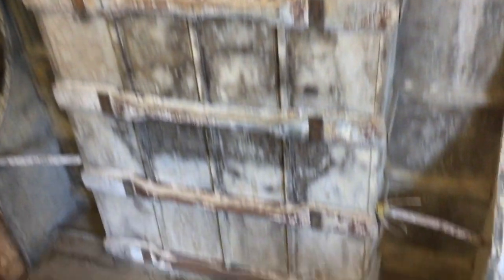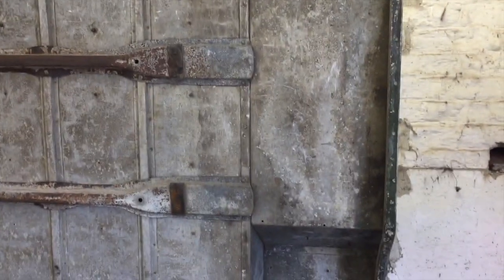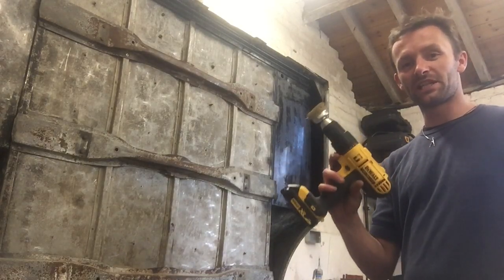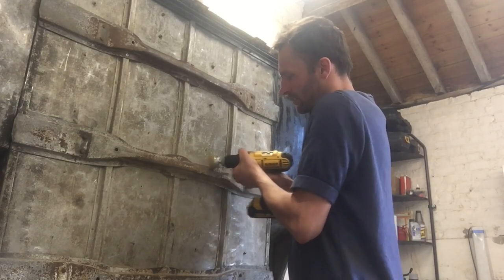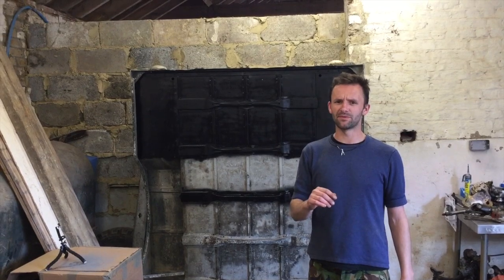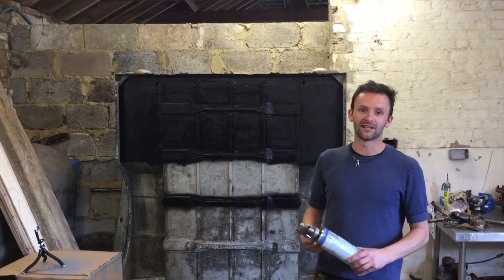As you can see, it looks alright. It's amazing the amount of dirt and just rubbish that comes off. So I'm basically just going to give it a quick wipe down with a cloth and then try some stone chip on this panel here. I haven't got a lot of it, so I'm just going to give it a quick once over and see how it comes out. Just quickly going to have a go with the cross braces - they've got a little bit of surface rust on them. Just got a wire wheel there. They're not brilliant, but if I can get the worst bit off. So there you go, that's the first bit done. That's one tin of quite thin stone chip.